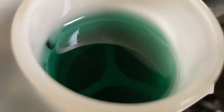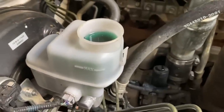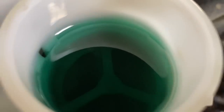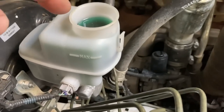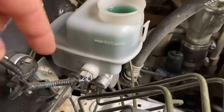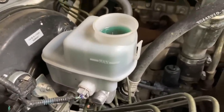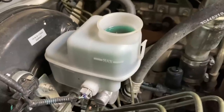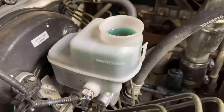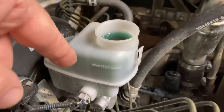What you want to do: there's a little filter in the reservoir. I'm going to evacuate it — drain it, suction it out. I'm going to suck it out. There's a little filter there, which I'm not sure why, because there's no debris going to be in the bottle bigger than that. We're going to take that out so we can get down as low as possible with a small tube into the master cylinder reservoir and suck it all out as much as we can. It's important that you use clean things — there's no point washing something and putting it in there with water because you need it to be clean and dry.